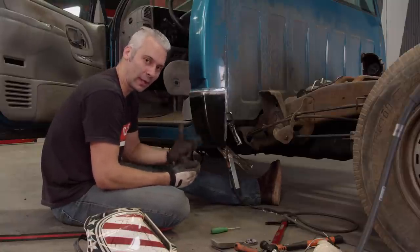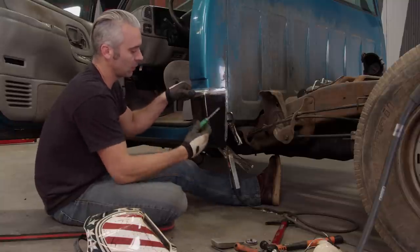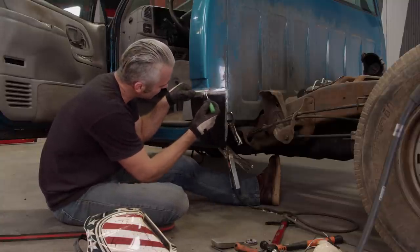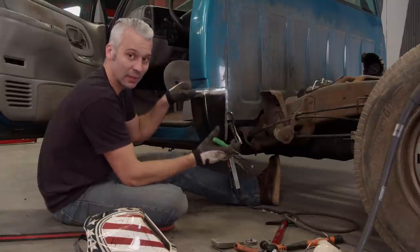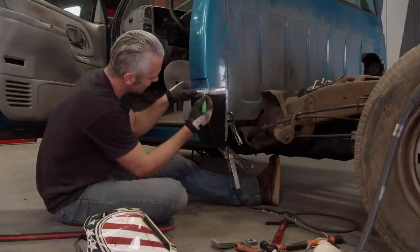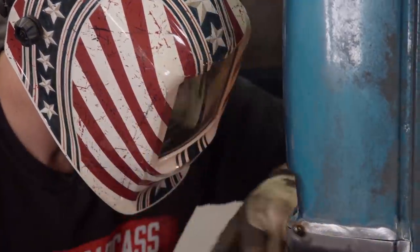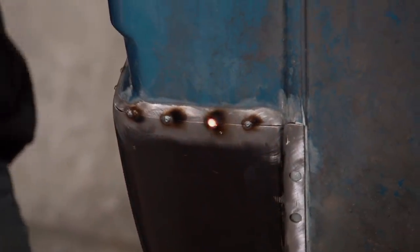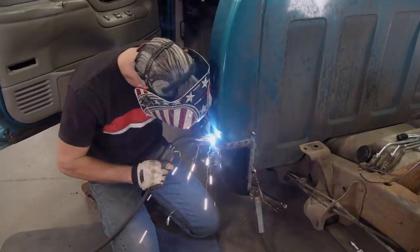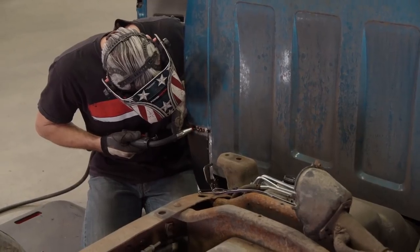A couple of things you're going to want: one, your welder at a low amperage — we're not looking for any structural welding here, just trying to hold two pieces of steel together. Two, and most importantly, a little tiny screwdriver. What you can do with that is get it up in between the two pieces of metal and shift it around — the closer you can get these parts to fit, the less body work you have to do. We'll throw the helmet on and put a couple tacks into place. We'll start with small tacks, then adjust the welder from there. Once tacked in, we'll start filling in between each one of the welds with a stitch weld — short pulls of the trigger. That way we don't drive a lot of heat into the panel causing it to warp.